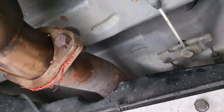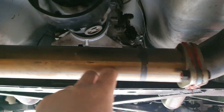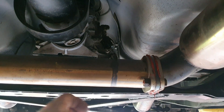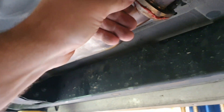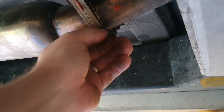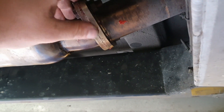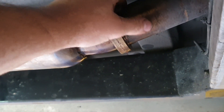Giving it a good jiggle — it's not touching now, so this side's pretty good, although it's a little bit to the passenger side. Once it's running and I know it's right, this balance tube will just get the chop. It was a patch-up job anyway — I joined two pieces of tube — so I'll get some new flanges laser cut, take that out, put it in my scrap stainless steel pile, and make a new balance pipe the correct width. I don't use gaskets on these flanges; all they need is a little bit of high-temp silicone and they seal quite nicely.